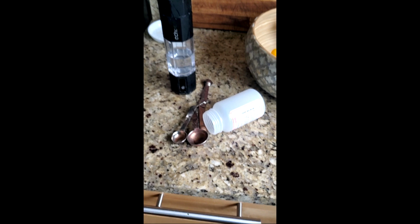And then if you don't ever want to have to deal with cleaning it, again, you can drink distilled water, okay? Or water that's softened. If you do have a softener at home, a softener will of course take out or precipitate out those minerals that would normally adhere to the cathode anode of ionizers, these water splitters, these types of devices. So if you have a softener, you will really not have to clean your device very often. I'd say give it a soak every 2 months, just to have it functioning as optimally as possible, because your softener doesn't work perfectly, but it works pretty darn good. It mostly takes most things out of the water. So that is another little tip for you.